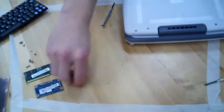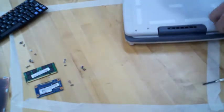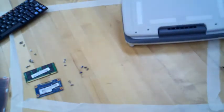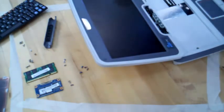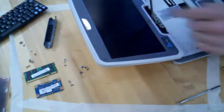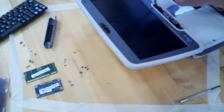These four screws on the lid — you don't need to remove those. That's for if you're getting inside the lid, but I realized after I took them out that that's not what we're doing. To get that gray plastic piece out, you're going to have to take two precision screwdrivers and pry it out. There are two clips in the back and then you've just got to pry it off the front. Once you're in here, there are going to be five screws — one in the center and two on both sides — securing two metal pieces in. The one in the middle secures the two cases together, and the two on either side hold the actual screen to the rest of the classmate PC.